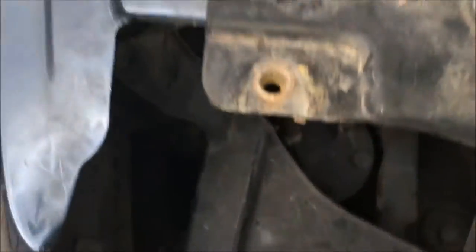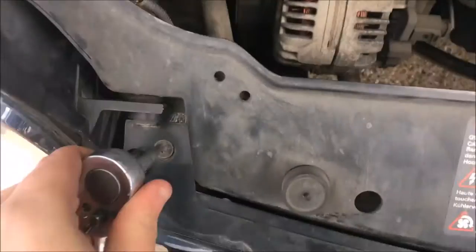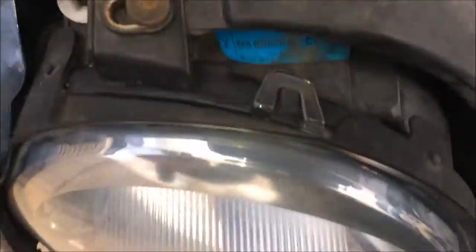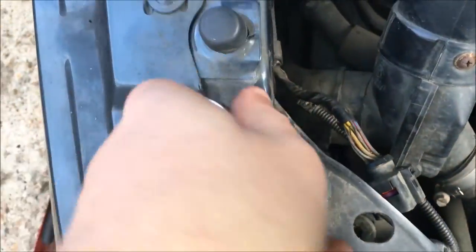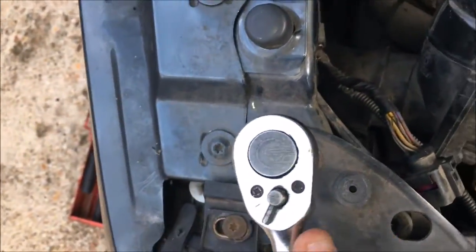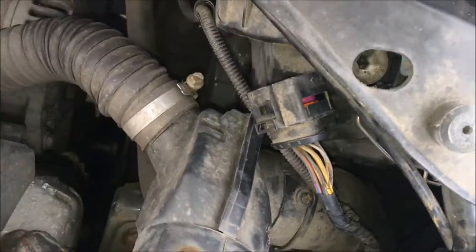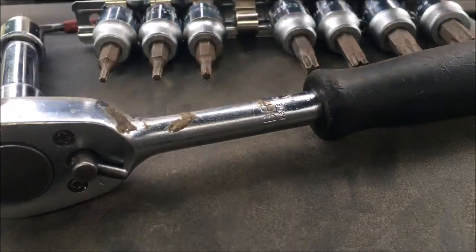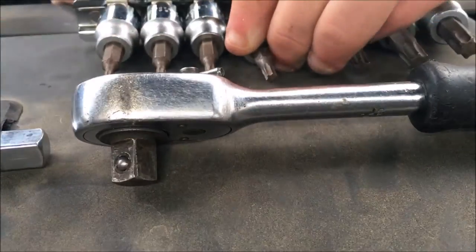Good thing to take the bulbs out. You can see the damage there — it's not looking great, and that's obviously why the grille clips just weren't right, just didn't sit right at all. That's something I'm probably going to look at at a later time. For now we're just going to put the headlight back in and tighten it up, make sure it fits okay so we've actually got light on the car and the beam lines up properly because it was dodgy. Just doing the four Torx bolts back up and that's pretty much done. Make sure you've got your electrical connection put back in on the headlight and check that the bulbs are working. I'm pretty happy I fixed something — just packing the tools away and that is it done.